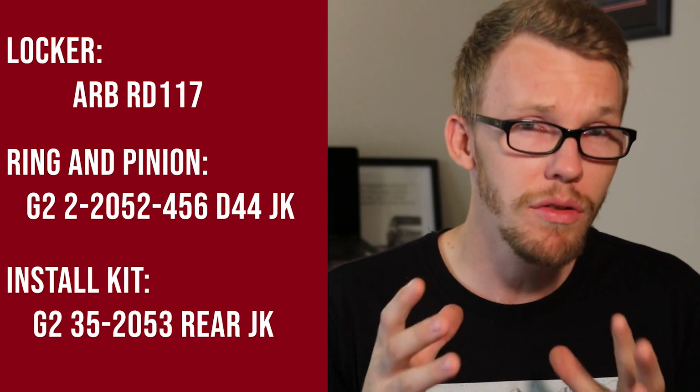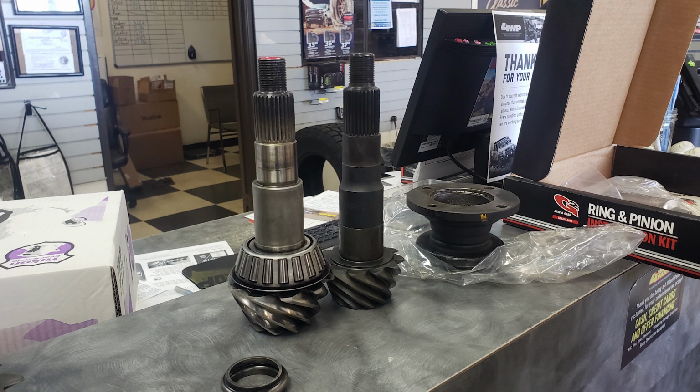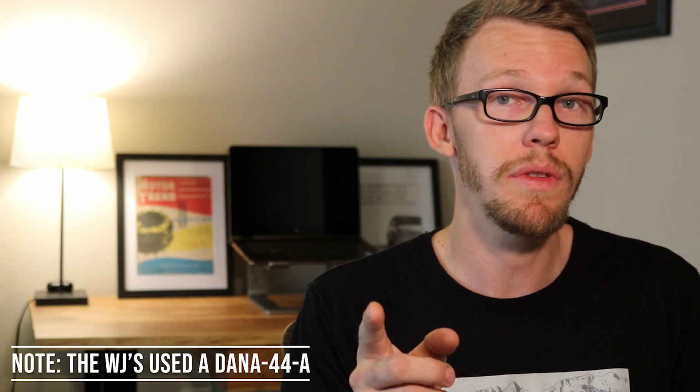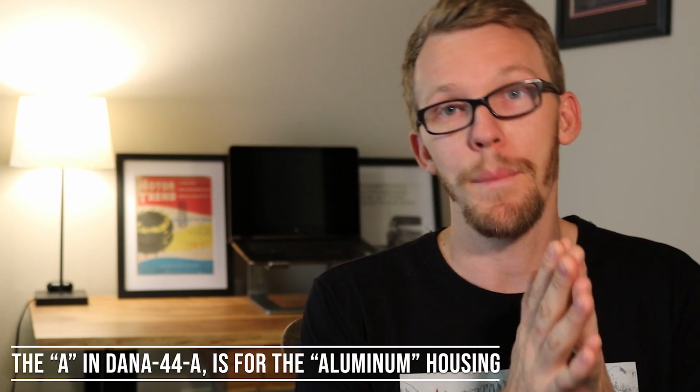But as far as the parts go, if you refer back to my other video about future plans, I touched base a little bit on the pinion issues that I had going on. There's a couple options out there. Me and JD were going over pinion options. What I ended up using was a Jeep JK, non-Rubicon, 456 ring and pinion, which is a 26 spline pinion. So I couldn't use the flange on that. But I did find out that the WJ Grand Cherokees, from 99 to 2004, I think, did in fact use a 29 spline pinion. So I could have used the original Isuzu flange and put it on that pinion and been good. However, it's a crush washer.